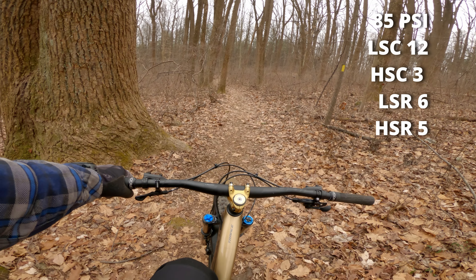This is my little tracking sheet — pretty much telling me all my settings from the closed position. First ride I broke my rear wheel, so I had that rebuilt and now I'm back a week later. What I'm going to do is change my low speed compression — maybe change it out to 12 clicks. For this run I'll keep everything else the same and just keep going to see what it feels like. So we take the low speed, which is right in the center here, and open it up two clicks: one, two. Let's go for it and see what it's like this time.